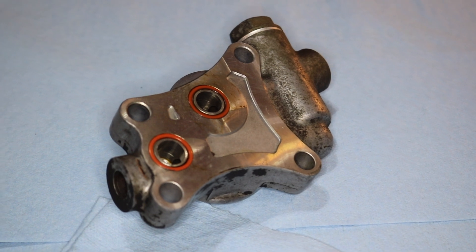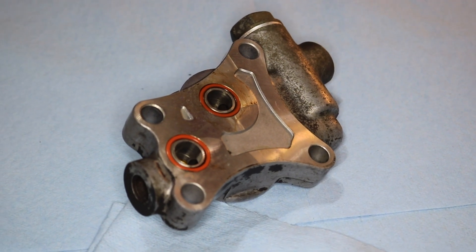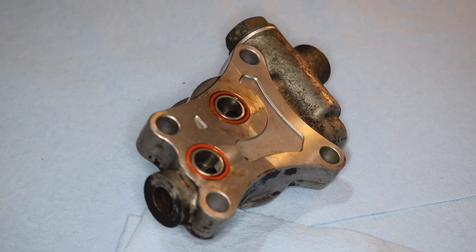If you haven't already caught it, these are all pretty common scenarios, which means that there's always a little bit of dirty oil that's not being filtrated by your oil filter and is instead being sent to your oil galleys to lubricate your bearings, your cylinder walls, your camshafts — the whole nine yards. It may just be a little bit, but it's important that your engine stays lubricated as best as it can.